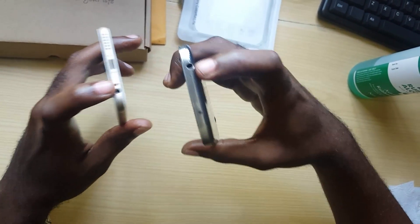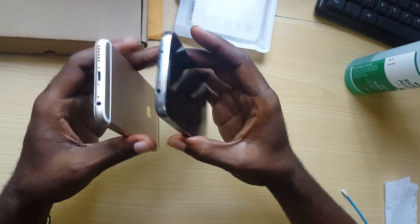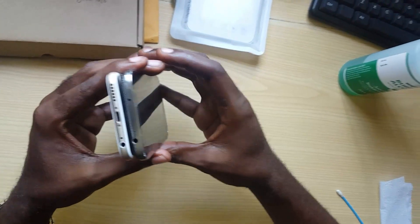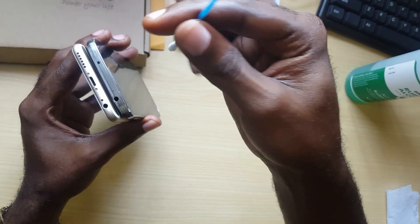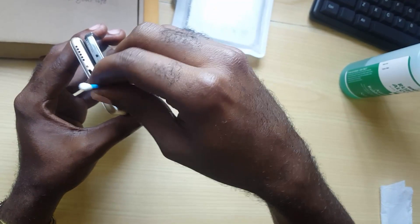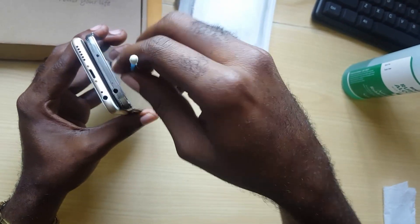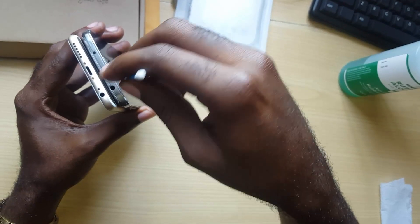As a result, when you try to play music on either device you'll realize you're not getting any audio. To fix this, all you have to do is figure out a way to get into the ports and clean them out. I suggest that you use a cotton swab or a q-tip — you can actually remove some of the lint and clean out the port.